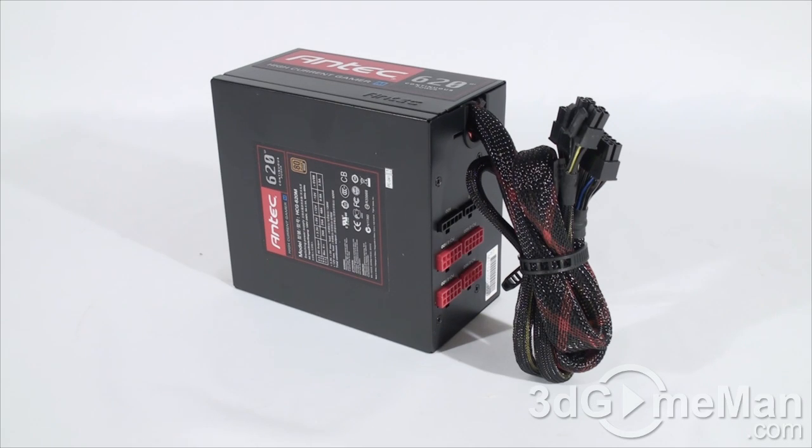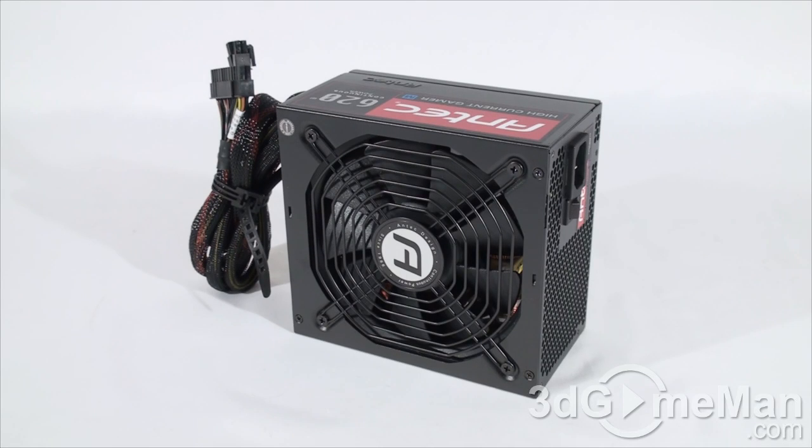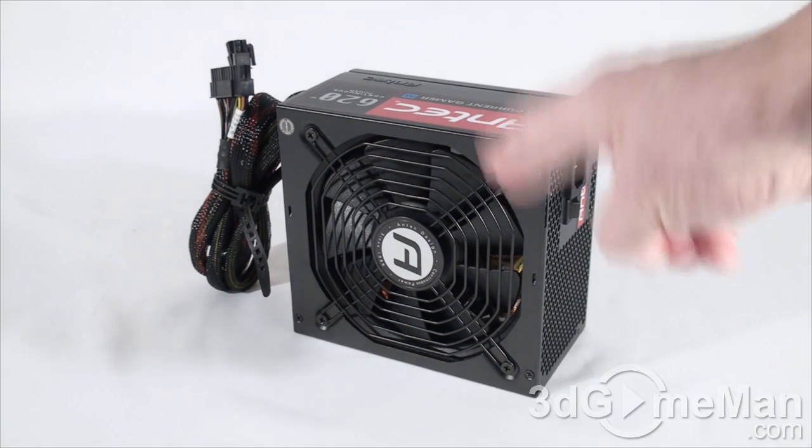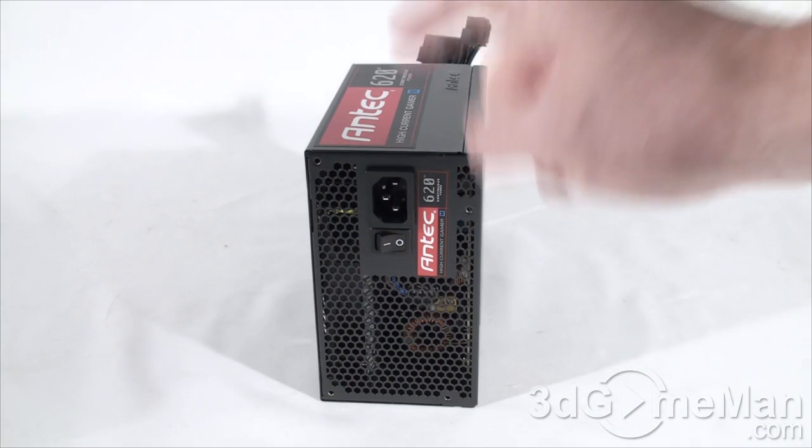If you are building an extreme gaming rig with a top-of-the-line multiple video card setup with lots of other hardware, select a power supply that's 1,000 watts or greater. Second, it should be at or above 80% efficient at typical load — the efficiency of this power supply is up to 87%. Third, it should meet the latest ATX and other current standards, environmental directives, over-voltage, under-voltage, and other protections. This power supply meets all current standards. Fourth, I'd recommend choosing a power supply that has APFC — Active Power Factor Correction — which assists the power supply in being more efficient and therefore stable under load, reducing total harmonics, correcting input voltage, and allowing for full input voltage range. This power supply has APFC.